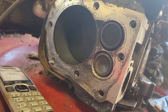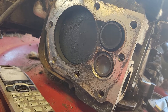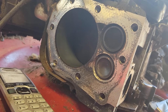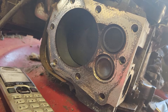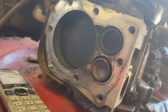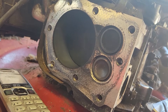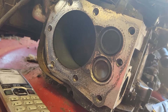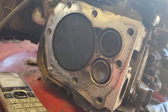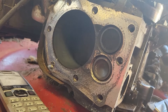Normally what I do is look for that intake valve to come open, but at that point the piston should be going down — it's not. My thinking is that when he hit the valve he's done something to the camshaft timing. Even though the valves are opening and closing, I suspect the cam is either twisted or the gear is off. I really don't know. I guess the way to go is to pull it apart, or I'll just look for another engine for him. The piston and valves are just not working the way they should.